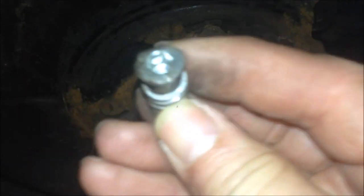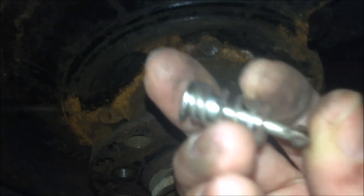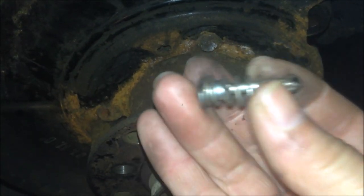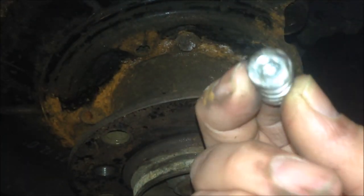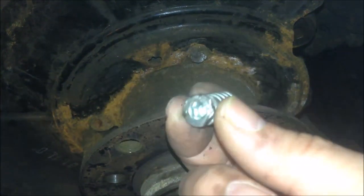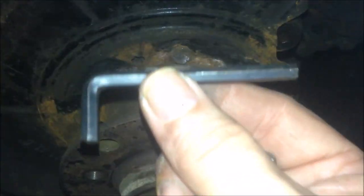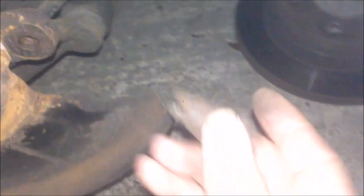You can see here is the pin. The cap of the pin had been stuck somewhere — you can see the damage too, but it's not too bad. I found another better spring, as one spring was crushed by the inside of the brake drum. I found a better one from the last time I replaced it. The cap of the pin is still fine. You use an Allen key — you push it and turn 90 degrees to put it on, and push and turn 90 degrees to take it out. I used this Allen key to remove the pin.